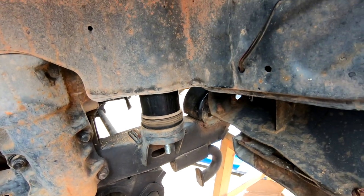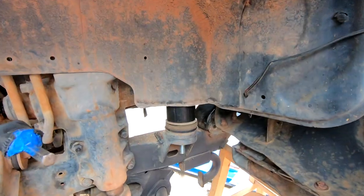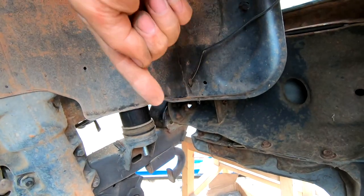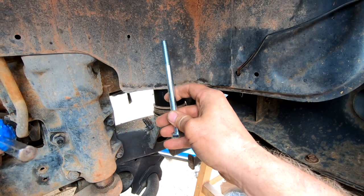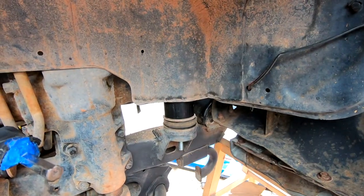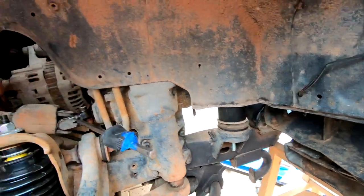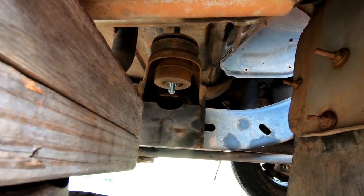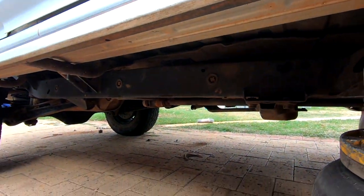A little tip if you're doing the body a side at a time: when you jack it up it puts the body on an angle. Getting that bolt through — with the hole in the body plus the block plus the washer plus the rubber — you have to make it go on a bit of an angle. What I did was put a bolt up through there to sort of line it all up first. If you've got two people this will be a lot easier — one pushes the bolt while the other wiggles things around until it comes out the bottom. I probably don't need to film the rest of this; if I come across any dramas I'll let you know. I reckon I might get this one and that one at most before I have to move the jack to the back of the car.